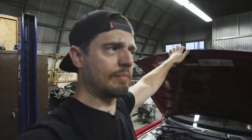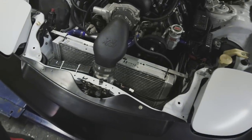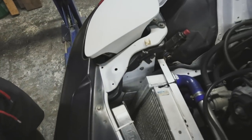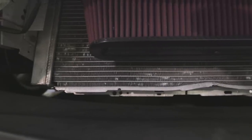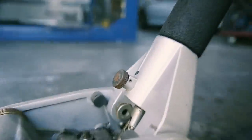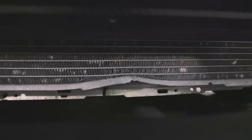The radiator we have in here now is actually pretty good. It's a Howe Racing radiator, which is what I put in when I first did the swap back in 2006. It's a really good radiator — I've never had any overheating problems with it — but you can tell it's kind of cobbled in there. A buddy welded up some tabs to hold it to the frame and it just doesn't look that great. There's no shrouding on it. Also, down below you can see some damage where the jack caught on it when I was lowering the car. The tube above it is almost bent, but nothing's wrong — just the fins below are bent. It might be a weak point in the future, so we're going to replace this thing.